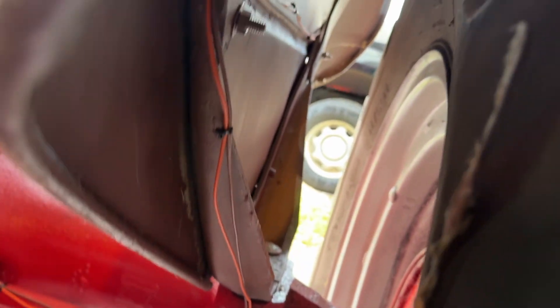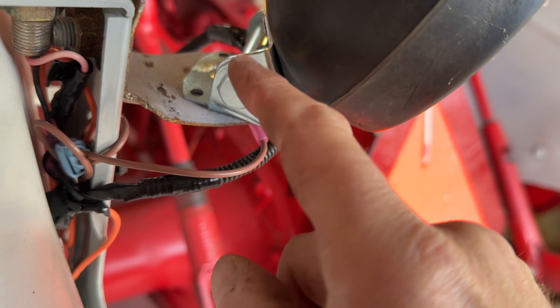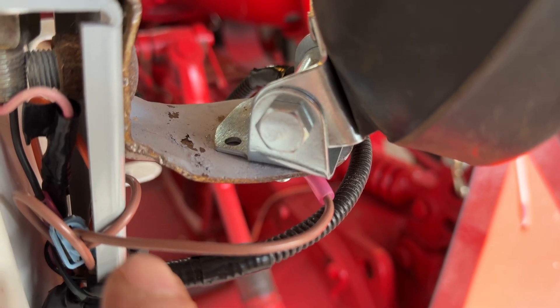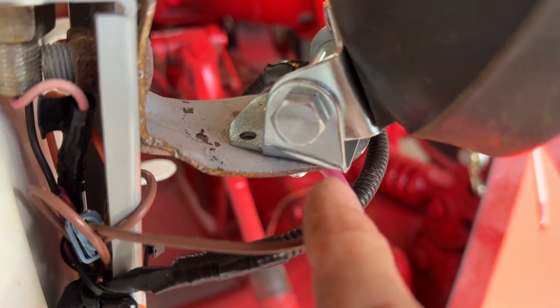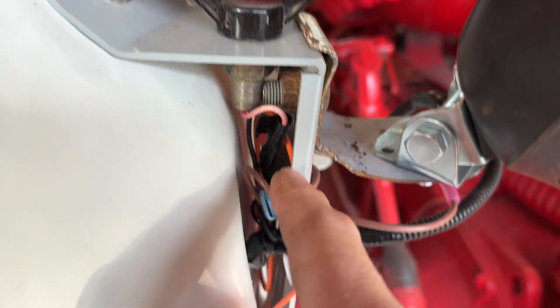Make sure you don't have wires hanging out in case of tire changes or anything like that. There should be a hole pre-drilled for your fenders. The ground comes up and I've got another ground attached here because the ground for this plow light is actually the post — the bolt that goes through. Since this tractor is negative ground and there's a bunch of different metals mated together through various bolts between the bracket and the battery, that's a good path for interference. The best way to avoid issues with paint or rust is to run a separate ground. The tail light has its own ground, so I just splice that into the ground wire here.